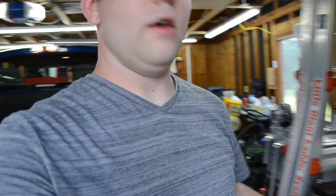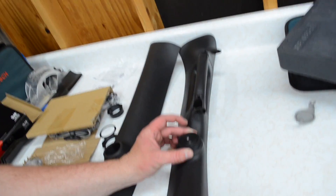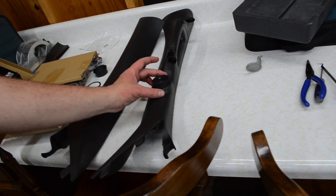Something I just realized is that you will need a Dremel because the speakers are too big to actually fit in the holes. These are three-quarter inch tweeters, and Kicker does have an inch size tweeter — keep that in mind when you're getting these. If you get the inch one, I think it's going to be too big because these three-quarter inch ones are already barely too big, and the inch one will likely overhang the round opening.